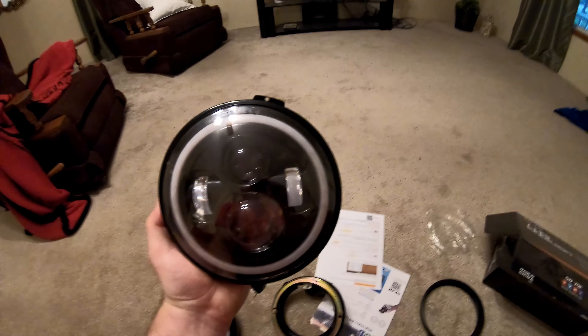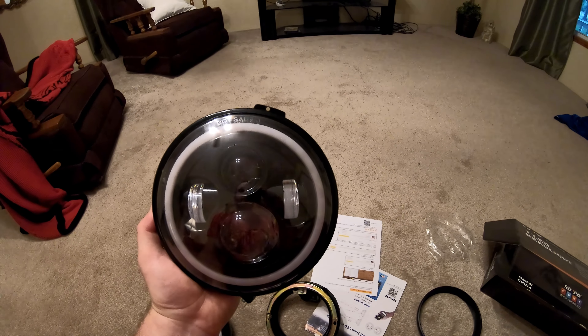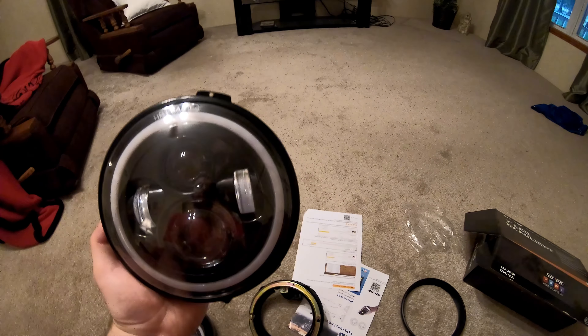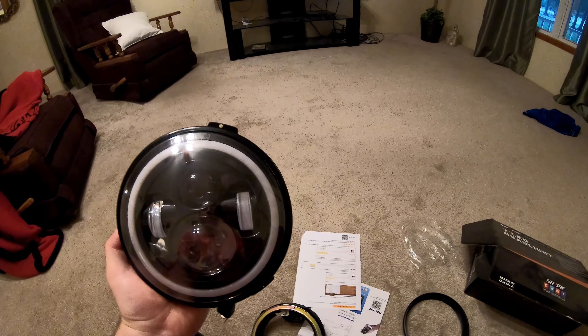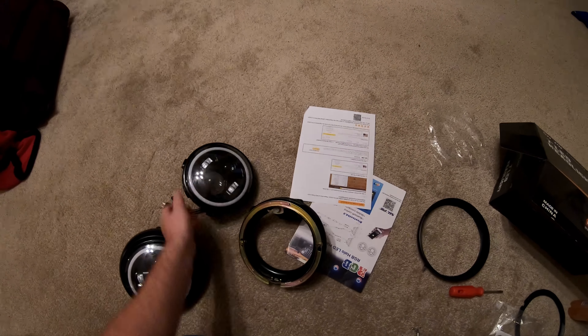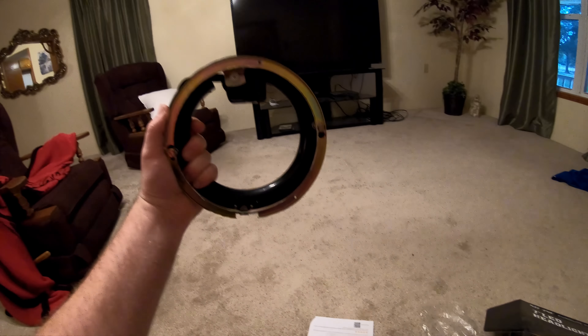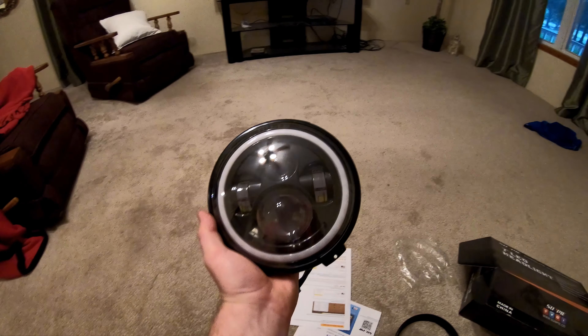This one is offset — look how the tab is not in line with the actual light. If you do that, you're going to get through all this and have a headache, because when you go stick it in your rig the light will look cockeyed. Just fit it before you get it all bolted up. You can actually take the back of it and slide it into your machine and it'll sit straight up and down, but the mounting ring will be crooked if that makes any sense.